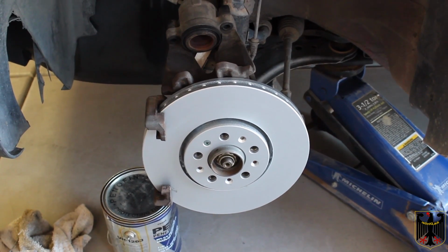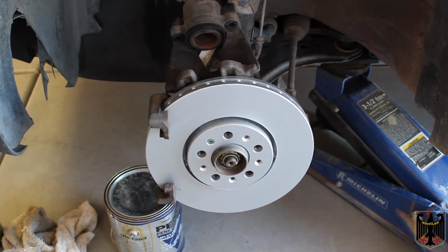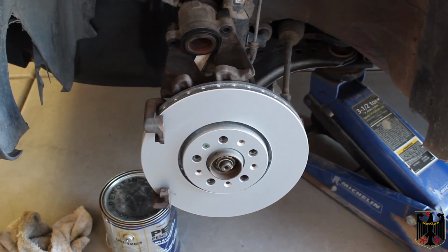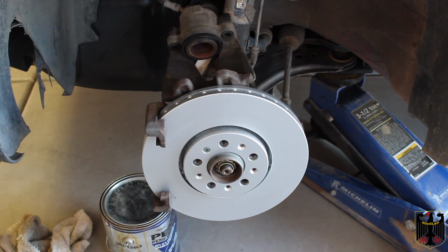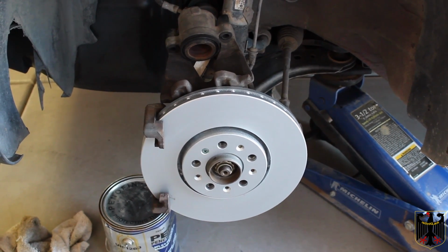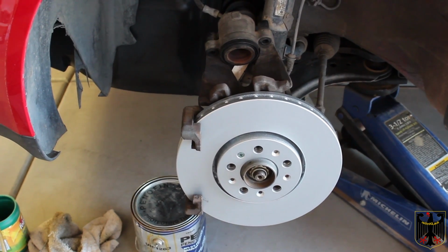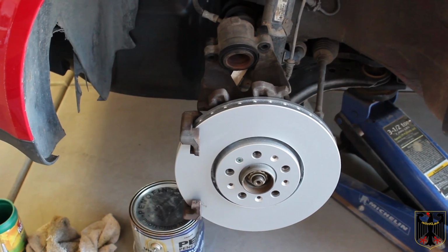We've now installed the disc itself, and we snugged the screw in real good. The kit came with a new screw, but it was too long, so we used the old screw and put some low-strength Loctite on it. Then we installed the carrier, and we're getting ready to torque it. I'll give you those torque specs here in just a second.